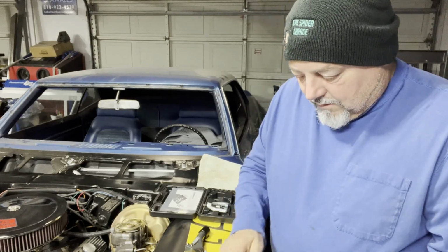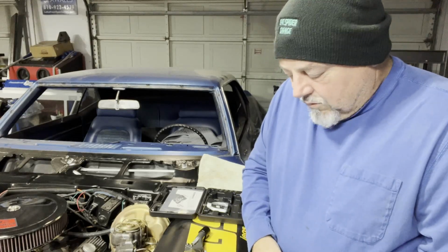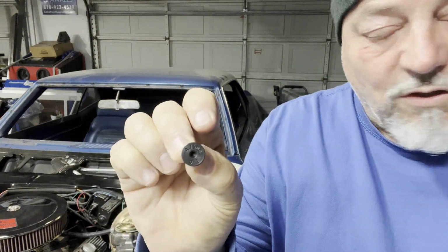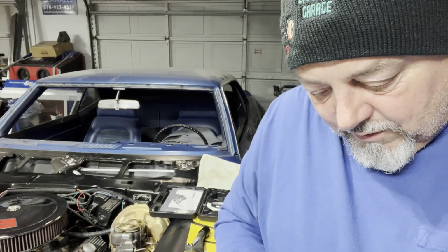Okay, I'm going to bring this side down. The reason we don't want to clamp it all the way yet is because we want to adjust the height. Since this is 3/16, I'm going to grab the 3/16 die. I don't know if you'll be able to read it because it's not highlighted or anything, but this is what the die looks like. Okay, there's a little stem on the back side. And what we want to do is just hold this against the tool, and I'm going to have to loosen that up a bit. We want to set the height of the tube to the height of the tool.